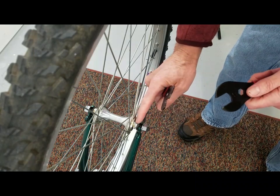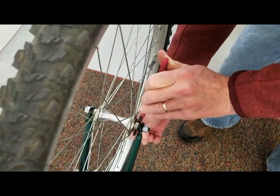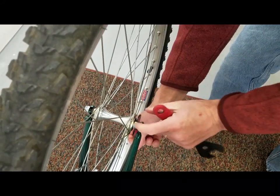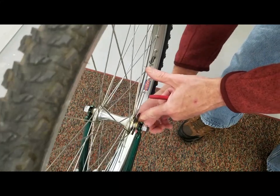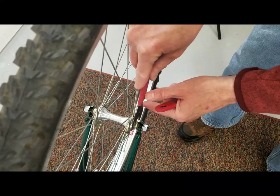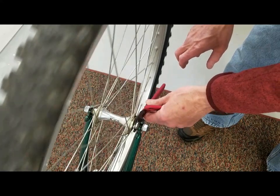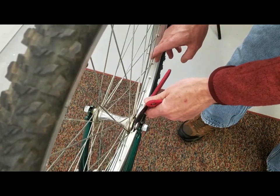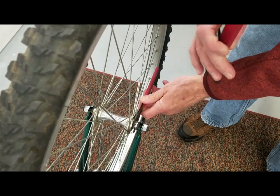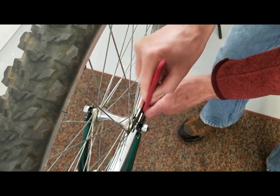The 15mm is the inside and the 17mm is the outside, which is our locking nut. Turn it just a little bit to lock it, then manipulate your inner race nut to the tension you want without messing anything up. A good place to be is just a little bit of tension, then back off slightly. With that cone wrench in place, tighten your locking nut.